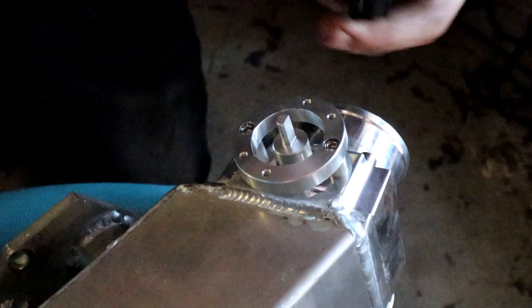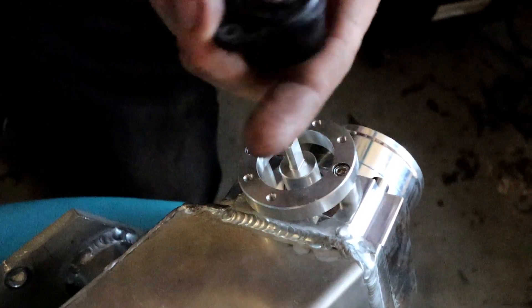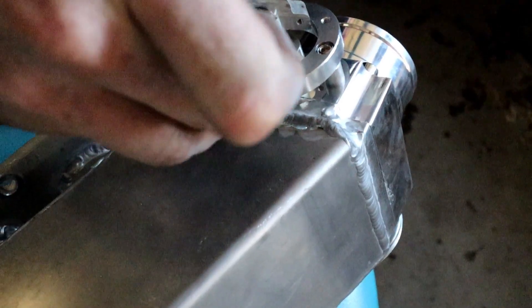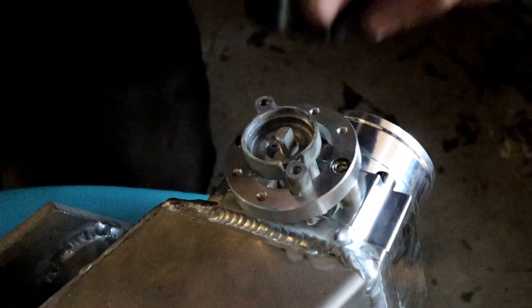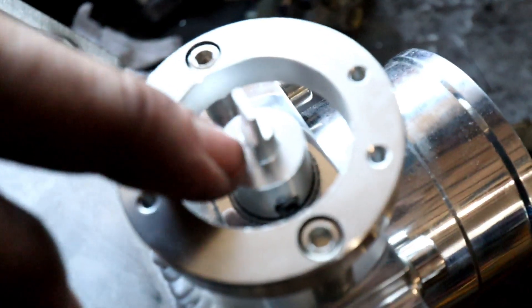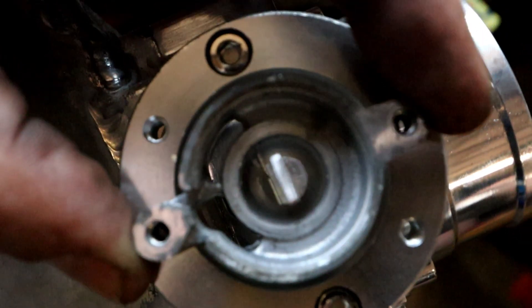Nick, do you see what's going on here? You could simply just drill new bolt holes and put it wherever you want it, but the problem is the TPS won't centre and it wobbles around. I've done this before and it just binds up and does funny things. So we've got this piece - we can weld that on there in the centre and then the stock TPS goes and bolts straight on. So we've got our chopped off bit from the throttle body, modified that pin there so it suits the TPS. We're going to get this roughly in the centre and then weld it on.